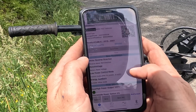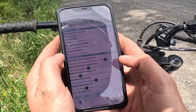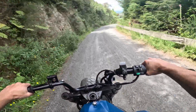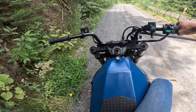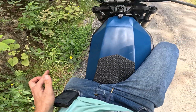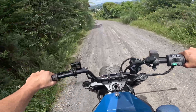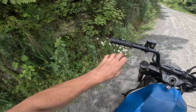If we go to the other app, let's see if we can put the regen on energy feedback mode. We'll try medium. She's regenning pretty hard now — it's steep and it's just regenning. My brakes can lock the wheel up, that's good, on downhill on gravel mind you. Let's try full regen — now we've got strong regen. It's locking the wheel, it's way too much regen.